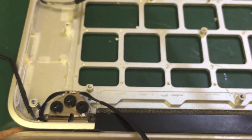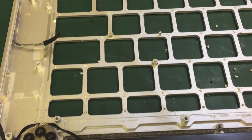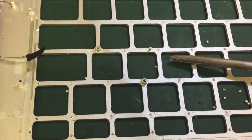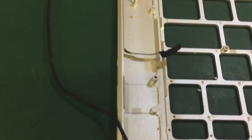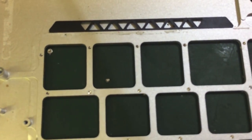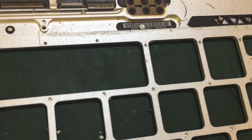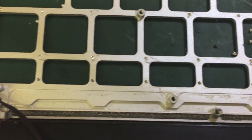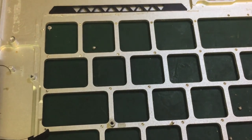Less than ten minutes start to finish — I mean since I started taking the actual keyboard. The actual rivet removal takes less than two to three minutes. When you get used to it, not even talking to the camera, you can do it in two minutes. Very quick, very easy. Not even a single rivet got stuck or broken. We have 100% success — I'll say 98% just to be on the safe side — but I reckon it's 100%.